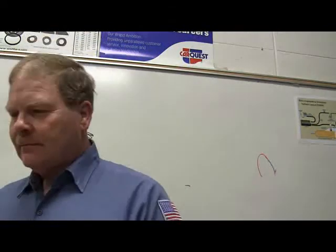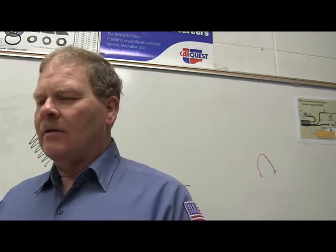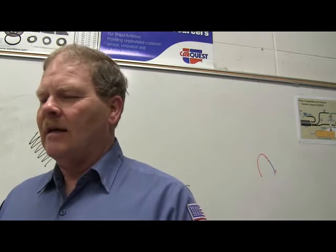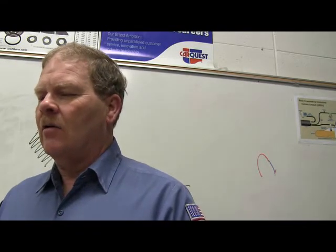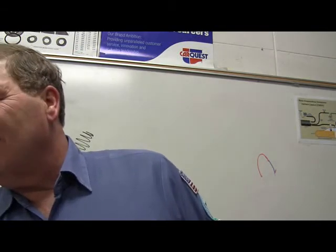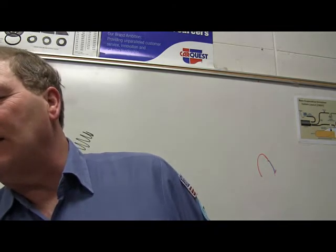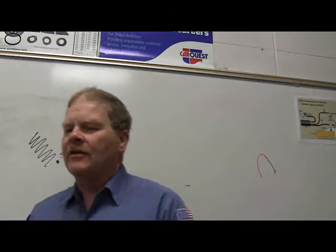Okay. Let's see. Number seven. Everybody keeping up with me here? Number seven, the instrument voltage regulator maintains an average of 10 volts of current flow to the gauge circuit. Well, what do you think about that? That's something you really don't have any way of knowing unless I tell you. And no, it's typically about 5 volts if it's got an instrument voltage regulator.